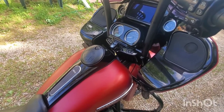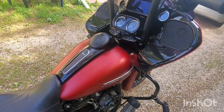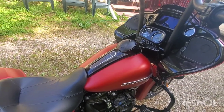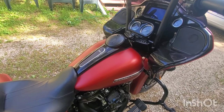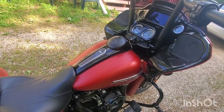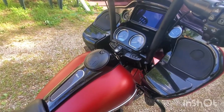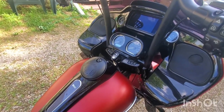I just went for a rip and the surging is gone - it ran great, had all kinds of pep. Before, every time I moved the handlebars it would rev a little, and going on the road it would kick - like vroom. That problem's fixed. The code is saying lost signal with the ABS, so the ABS light is on. It could be an easy fix or something I did - we've got to figure that out next. But I think we're good with the throttle. Please like and subscribe.